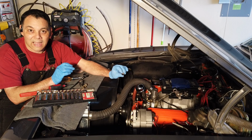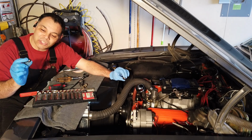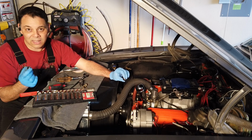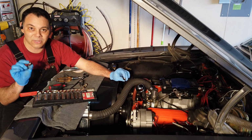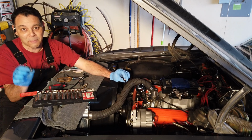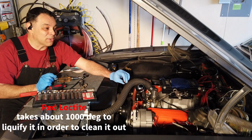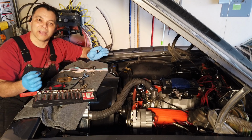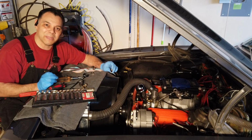I totally get that. I'm very much appreciative, but I'm pretty sure because of the color of them that they used red Loctite. And red Loctite, at least in aviation, is the strongest Loctite you can put on something. It's for things that are not meant to come apart. And that looks like red Loctite. I would have used blue, but they did come off. So now I'm going to swap them over, since my FiTech Mini is on the driver's side, and plumb it in from that direction.